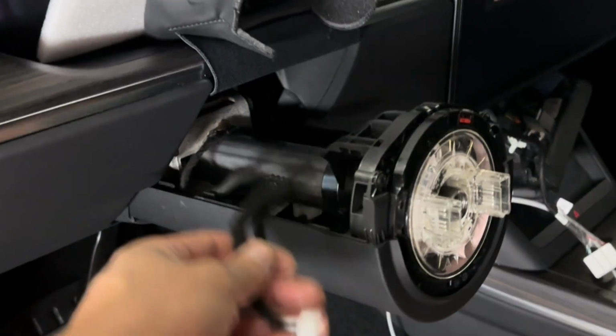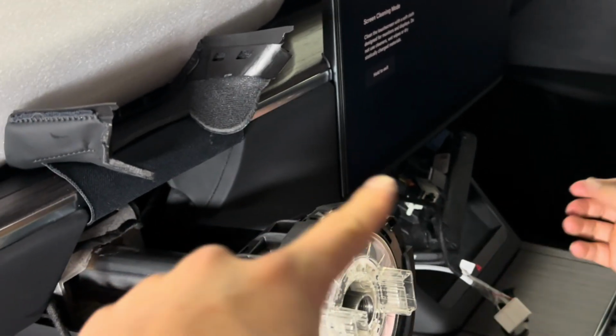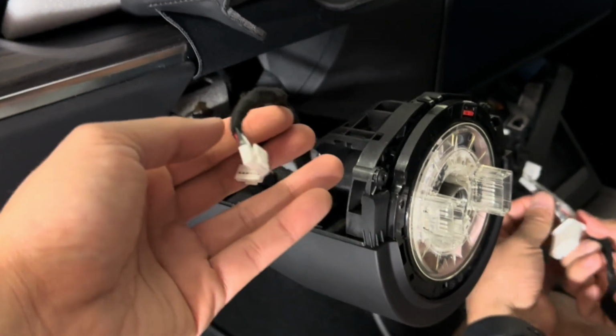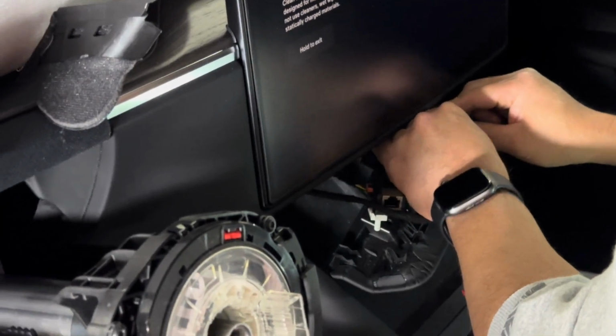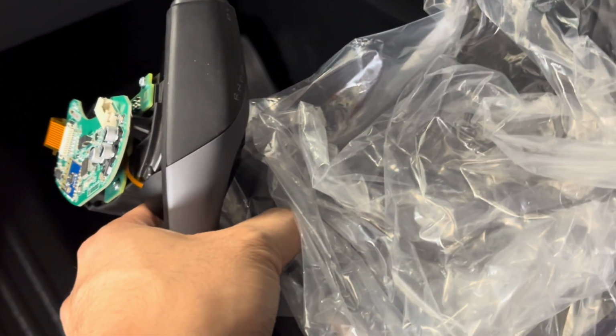All right, so here's the back wire, 2 and 1. The big wire stays with the blue OBD connector, and then you fish this one through. Then go ahead and plug in the OBD connector, and now install the stock column. You want to install the stock column first, and then put the cover on.